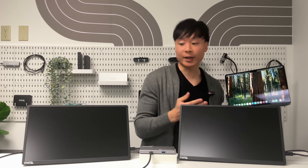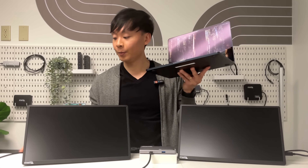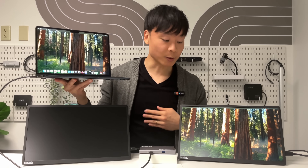If you take last year's M3 model and connect it to a dual display setup, such as this one with our USB 4.0 Hub 3A Thunderbolt Hub, what you'll see after a second is that only a single monitor will light. That's because the M3 chip doesn't support dual displays unless you have it in clamshell mode with the lid closed.